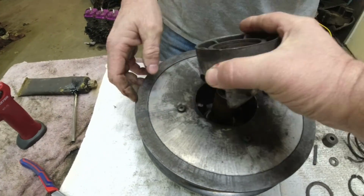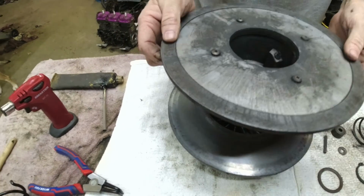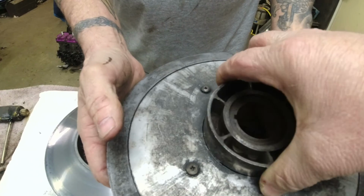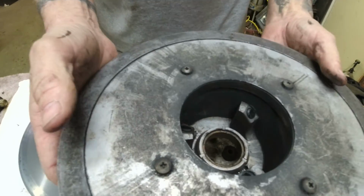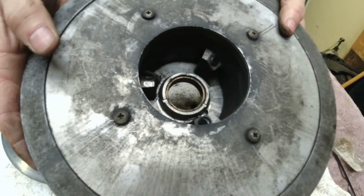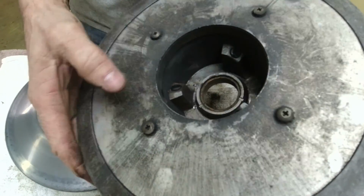Sounds good. All right, one of the huge reasons Lonnie's sled had that bog off the line is that his secondary is just shot, and we'll show you quick what we mean. So let's show them how loose this is. Actually, take that sheave off. Look at how much that moves. The bushing is down to metal and it's spinning around in there. The bushing's just junk. Surprisingly, the buttons still have some life to them.